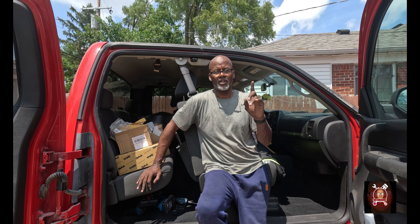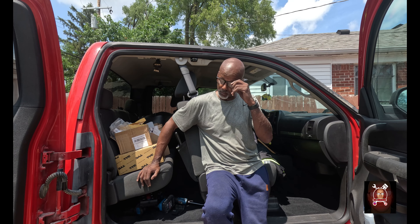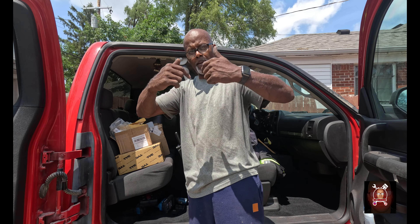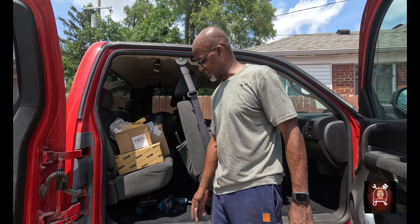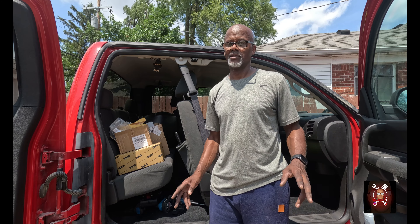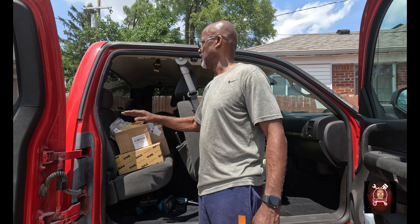If you got issues with a cab — Silverados, GMC Sierras and all those — they have those vents in the back as a pressure reliever to make it easy to close the doors. It's also a leak point if they're cracked. Check those first — just look between the cab and check the top of the seal if it's broke. If water's running down through the back area and it's getting wet, it's running down through there. Look at those first — you're under 50 bucks for them, which is way better than buying door seals. Only issue is you've got to take the back seats out.